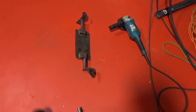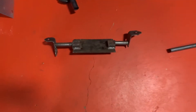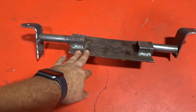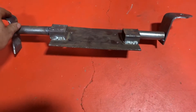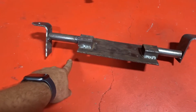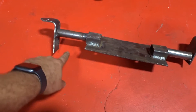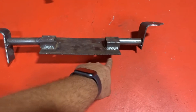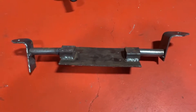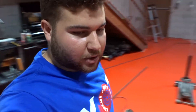So we can kind of create the transmission mount. The idea is we're gonna keep this bottom plate right here and make two 90s to create a U-shape. The pipe is gonna come from down here, make a 90, and bolt to the chassis of the car, and then the same thing on the other side — 90 and it bolts to the chassis. This is our first time using this tube bender, so let's go ahead and give it a try and see what we get out of it.